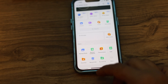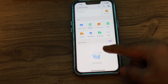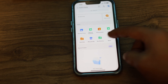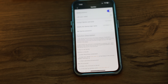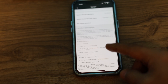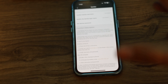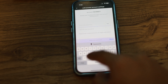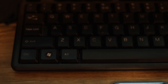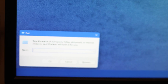I've been going around the app and there are other things you can do here. One thing I found is that to access this on my computer, you go to More and then you'll find Samba. Samba is like a network drive for computers. You can see the details there — this is the IP address of the personal cloud storage. If you're going to access it locally on the network, you can use that IP address. I'm going to set a simple password so we can try to access it. After setting it up, go to your keyboard and press Windows plus R — a run prompt will pop up in the lower left corner of your screen.